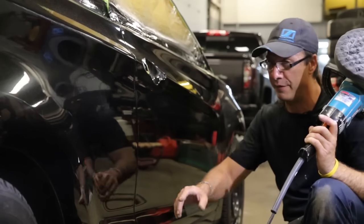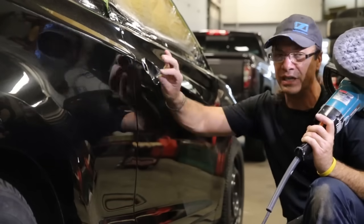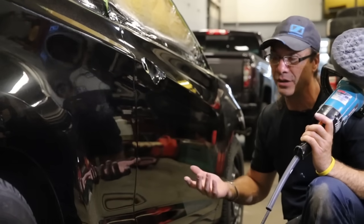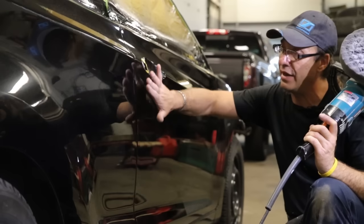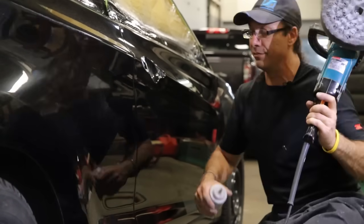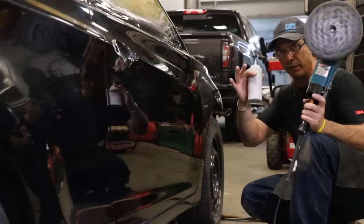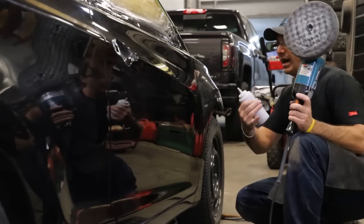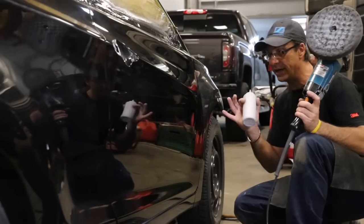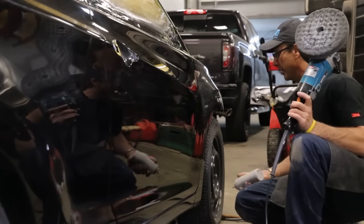You'll have the corner of a bumper where the painter just didn't get enough clear around that edge — it's really super dry. Dry means there's no clear there. Either he's going to re-clear it or you just lightly do it and polish it, and hopefully the customer accepts it. With skipping the step from compound straight to the foam pad, you may want to take a little bit more time with the foam pad, create more heat on the surface, and work that clear out a little bit more because you're going to need it.